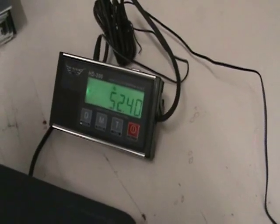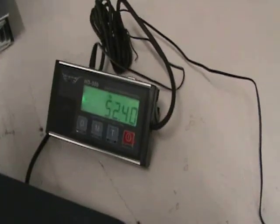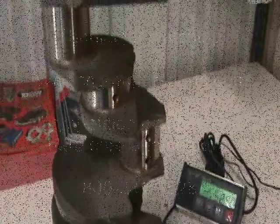There you can see the weight of the one-piece crank: 52.40 pounds. They're going to vary a little bit, but this is a UPS scale that we use for shipping — it's extremely accurate. So there you can see the differences between the one-piece, the two-piece, and the forged steel.